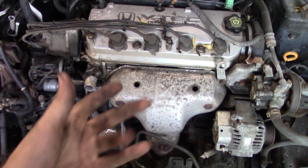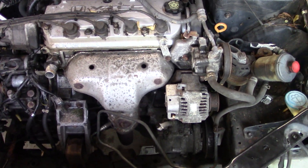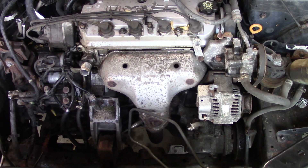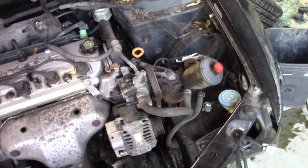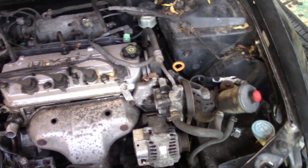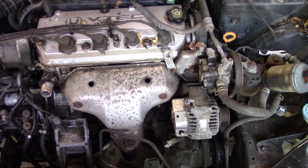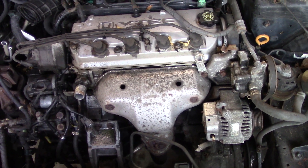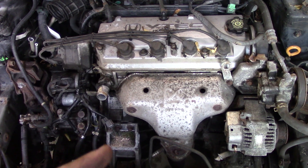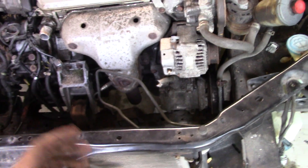The radiator is still yet to be determined — we may run a radiator or just loop it, because these Honda engines will run one heck of a long time with looped lines. Usually in team shows the heats are very fast-paced so it's probably not going to overheat during that short time. The main debate with the alternator is this: if you put an alternator on it, yes you have it charging your battery, but when this thing finally gets hot enough to shut down, you're going to want all the power in your battery that you can get to refire this engine.